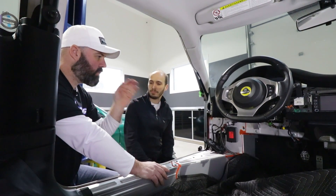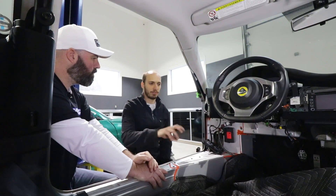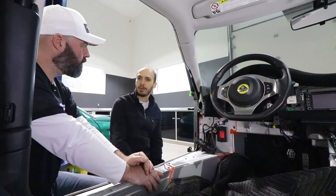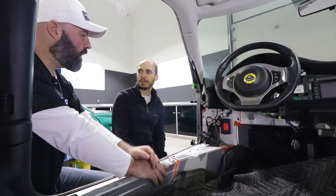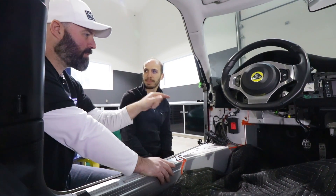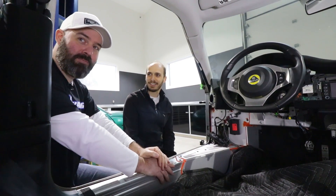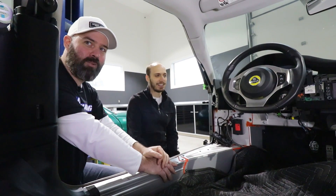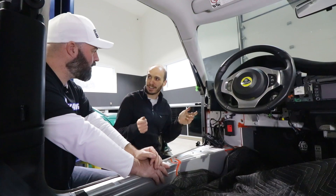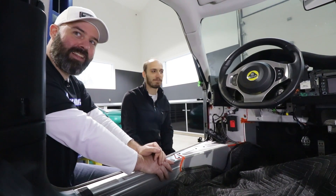When you hit the brake pedal at the racetrack, it'll all be customizable — we'll have different modes and tune it to see what we like best. The MoTeC will know the brake pressure, so it'll be able to request regen either from the paddle or from the brake pressure. If you can program it so that in track mode the pedal also engages some level of regen, that's totally possible. Getting advanced, the regen paddle could even become a dynamic brake balance adjustment — coasting into a hairpin, you squeeze it a bit and it's basically like adding a little rear brake bias to help get rid of understeer. That's a pretty cool idea.